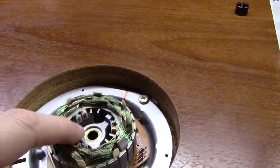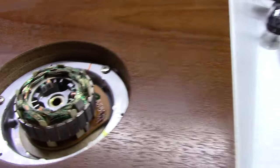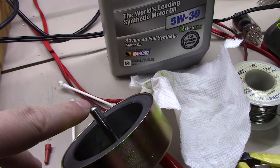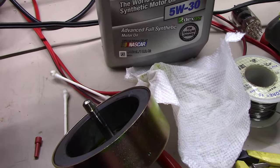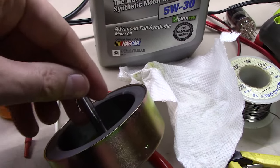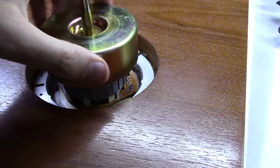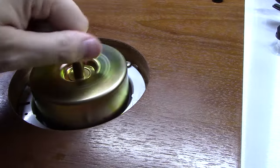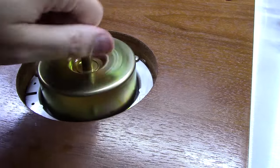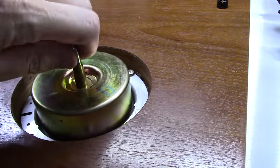Always be careful: if you've got the bearing wheel open, don't flip it upside down. The Marantz doesn't have this, but a lot of Technics do — they'll have a recessed area on top of the spindle with a little round ball bearing, and if you turn the table upside down, the ball bearing falls out. This one doesn't have that. Then I'll come over and put a little bit of oil on the cleaned shaft and work it up and down and around with my fingers. That thing is pretty much ready to drop back in. Drop it back down carefully, center it over — it'll take a little bit to settle — and look at that thing now: it spins freely. Before, I couldn't even get it to turn a single turn.